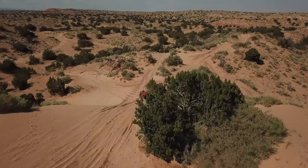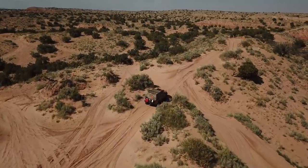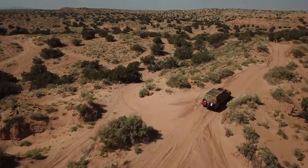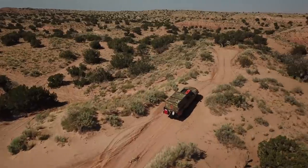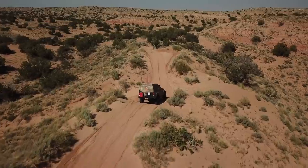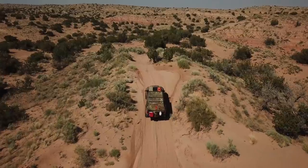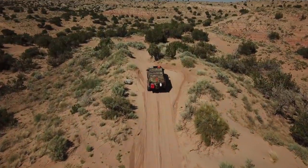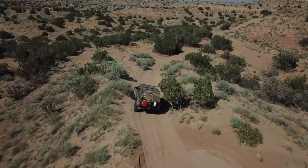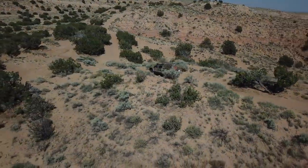and sliders. In the rear suspension, we're running a custom Alcan leaf spring pack, which is what we put in every one of our builds, the stage 1, 2, and 3. All get a custom leaf spring pack because the suspension is the last thing we consider when we're talking about a build, especially of this size, because we need the truck to do a certain job. So once everything is on the truck and we know how the truck's going to be driven, then we look at how to carry all of that weight. And that's where the spring rates come in, the valving and the shocks come in, and which suspension stage is going to work best for that client.